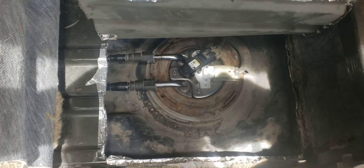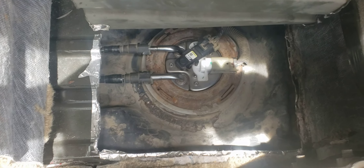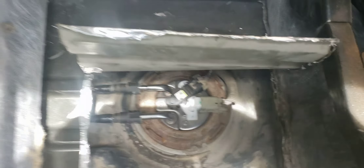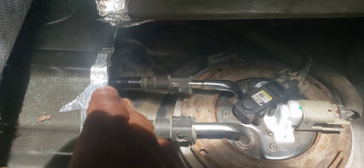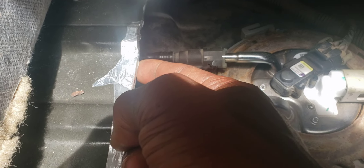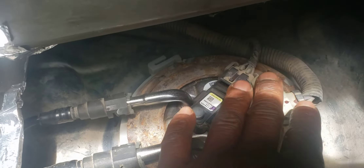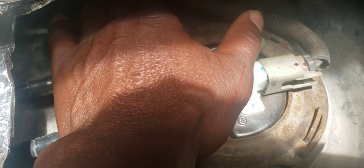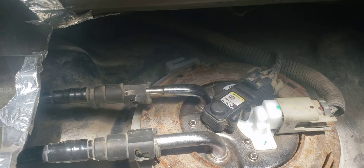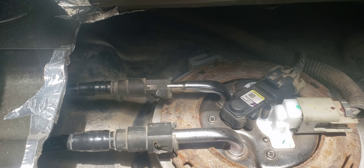This is how I did it — with those three tools, I got it done in less than an hour. These two gas lines you can't get mixed up; they fit accordingly and are about an inch lower than the frame. When cutting, if you see that black, stop — you might hit something essential. The other wires on top run underneath that frame, and they seem pretty well out of the way as long as you do a proper install.